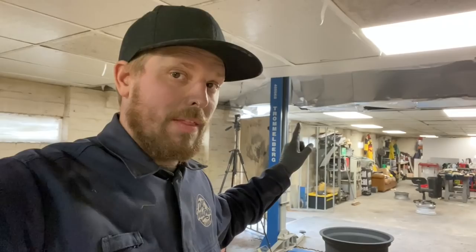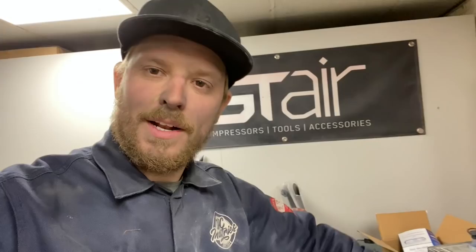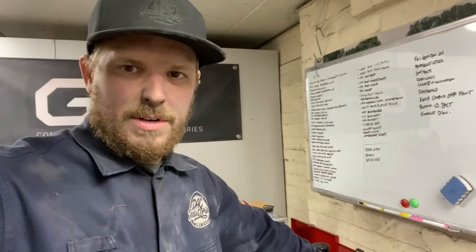These have been etch primed. These wheel faces, excluding the one that's no good, have now been sanded back from the high-build primer. I'm not high-build priming the barrels because I haven't got enough — I'd rather the faces look good. So what colour are we going to be painting the faces? Gold, obviously — I think everyone saw that coming. I did a bit of research on forums and was told that the closest match to the BBS colour was Subaru GK1, which is the closest to BBS gold as far as I'm aware. So I've mixed some of that up.